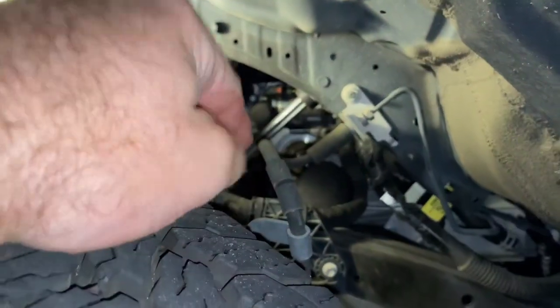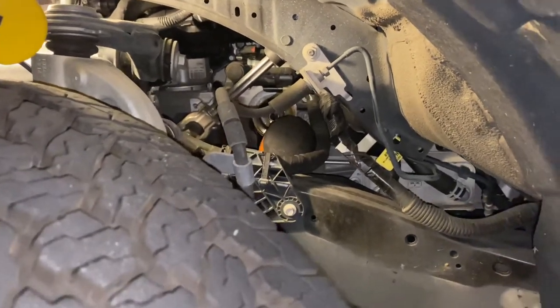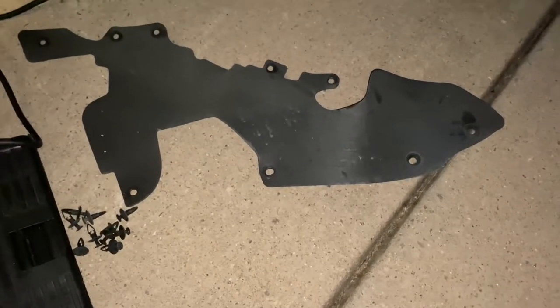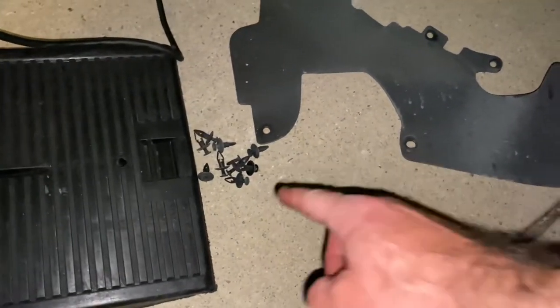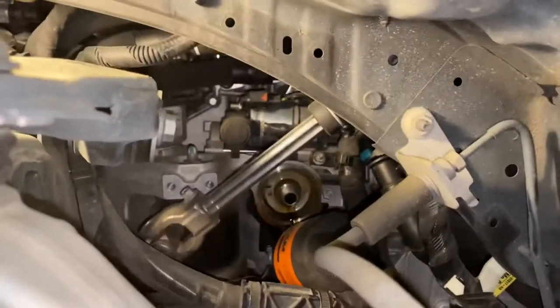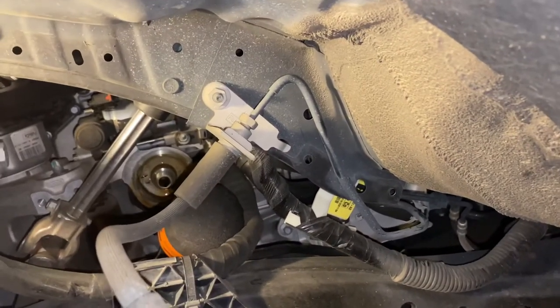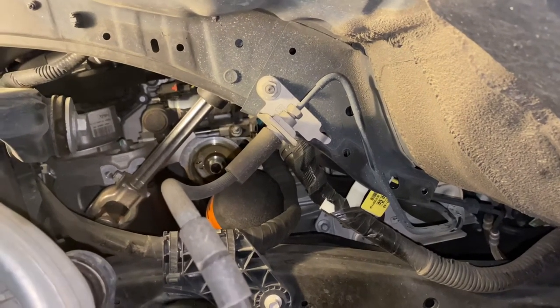Just to let you know what I had to remove: the tire is still mounted, I just turned it to the left as far as I could and I have plenty of access. What you do have to do is take off this mud guard — I don't even know what you'd call it. It had about nine fasteners, which is a little bit of a pain to take off. But it makes it so much easier to reach that oil filter. I'm debating whether to even put it back on, but I probably will since I only change my oil every six months or so.